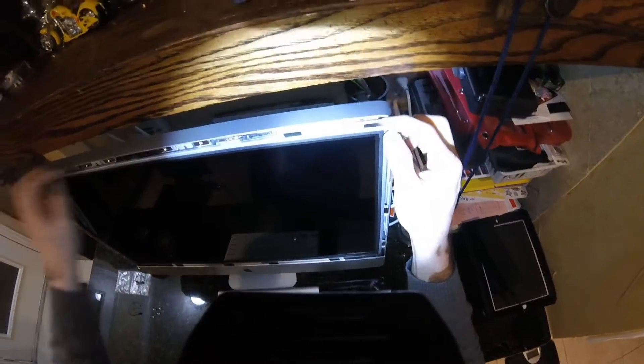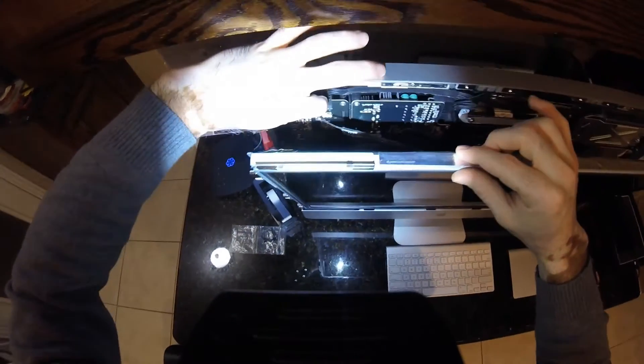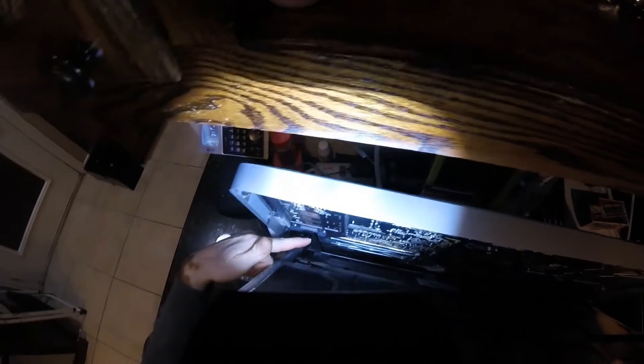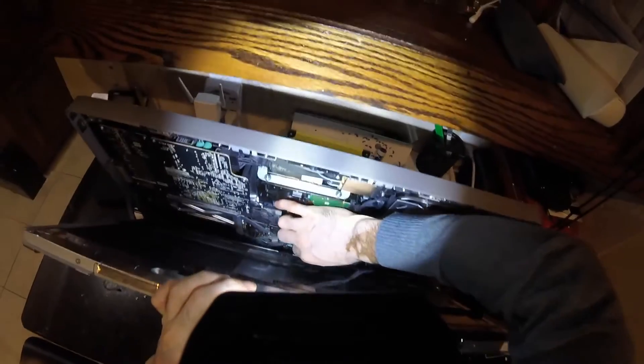After you take off all eight screws on both sides, the LCD has a little frame — you can use your fingernail to pry it out slowly. Don't pull it off though; there are a bunch of cables inside. The first one you're going to see is right there — that is some sort of control connection for the LCD with four wires and a little notch. Use your fingernail to pry it straight out. Before you open this, be warned there is high voltage going to the LCD through this connector, so make sure you disconnect the power cable first — I got shocked and found out the hard way.